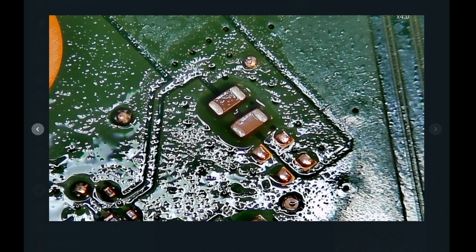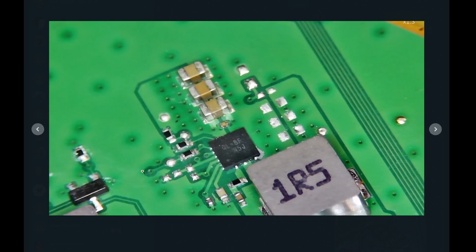We had to increase to 1.5 volts — believe it or not — to find that the capacitor was causing the issue. Another case of a component less than a grain of rice causing a short on the Xbox. This would normally be deemed a no-fix.